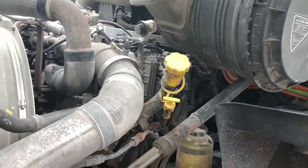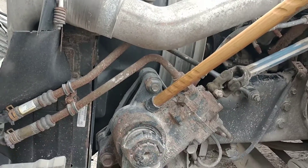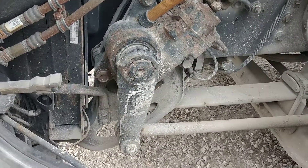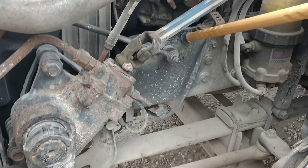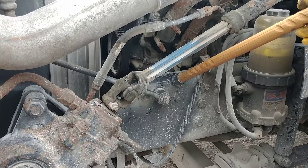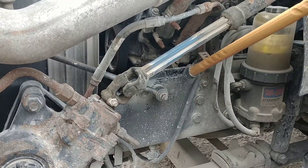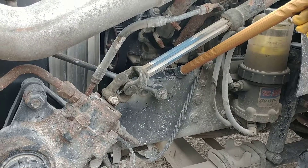You don't need to do the steering column or U-joint anymore. Power steering gearbox — properly mounted and secure, not missing any nuts or bolts, not cracked, broken, or leaking. I want to check my frame as far as I can see in both directions — properly mounted and secure, not missing any nuts or bolts, not cracked or broken. It needs to flex, so I'm checking that there are no welds and no holes have been cut or torched into it.